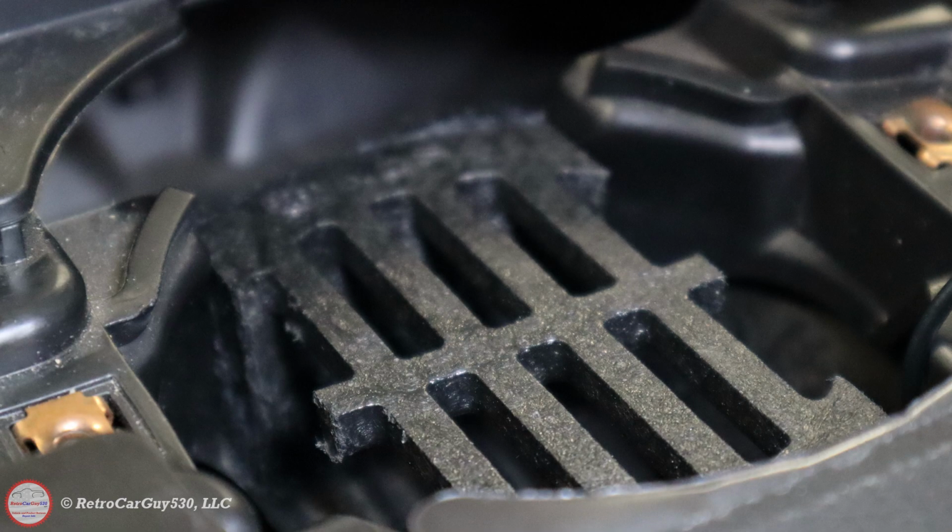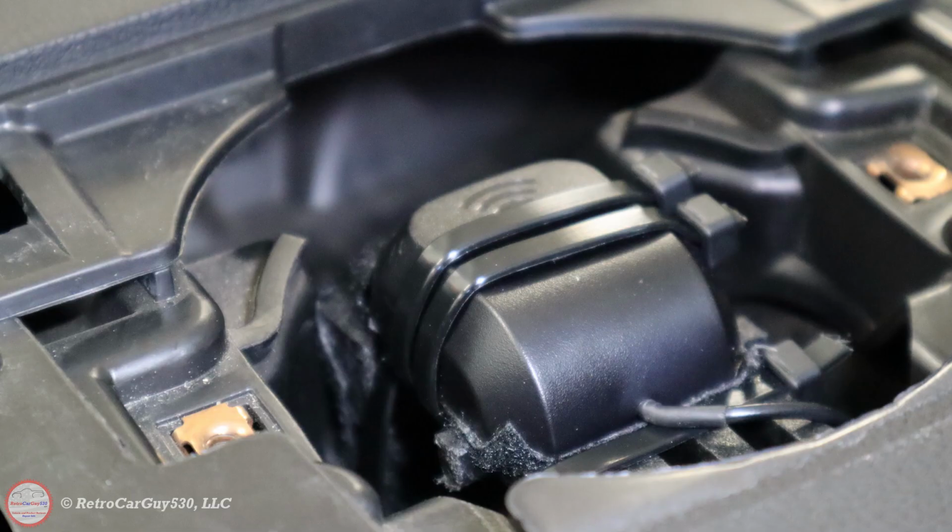The preview channel worked just fine, but when I activated the radio, other channels were cutting out at points that they shouldn't have. So I bought this drain grate cover, cut it down to elevate the antenna and point it a little bit more towards the front of the vehicle. It helped a little bit, but there were still areas where the signal strength was dropping, so I knew I had to put the antenna on the outside of the vehicle.